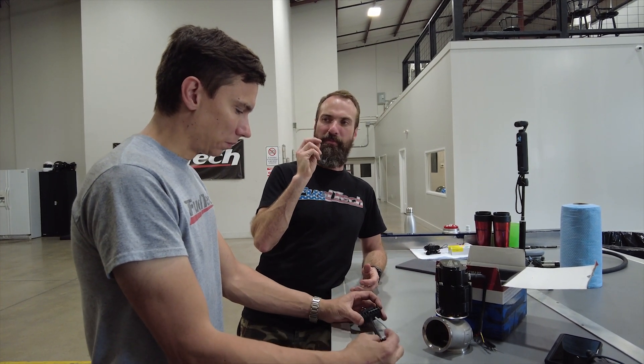Going back to the feature itself, it's not much different than the boost controller feature. The biggest difference is the target — you're not manipulating the dome pressure anymore. You're actually manipulating what your boost target is. You don't need to guess how much PSI to do something. The biggest difference is now you have direct actuation over the gate. The biggest challenge about controlling boost — the intake manifold pressure — was that you had to control a dome pressure that would control the wastegate position. Now we're jumping directly to actuation on the wastegate valve.